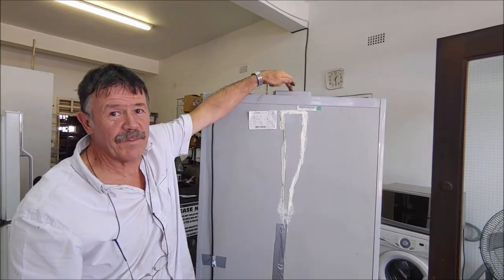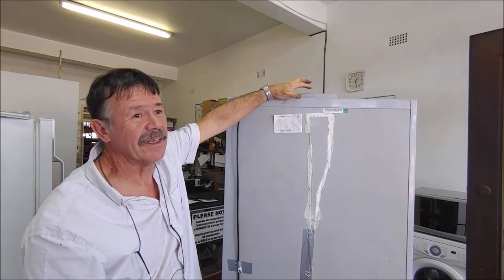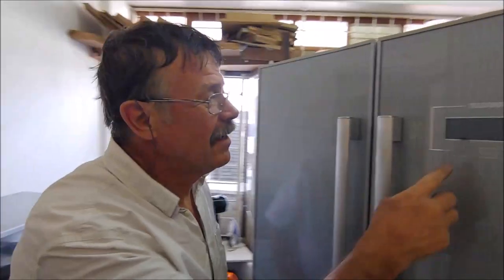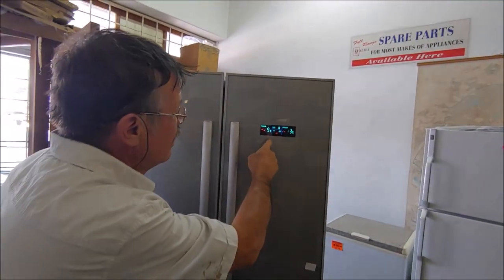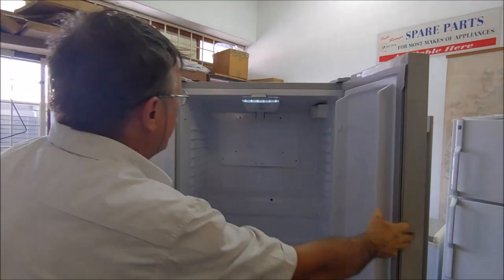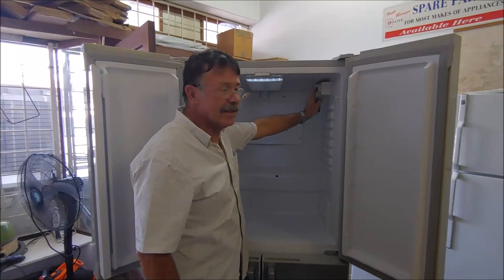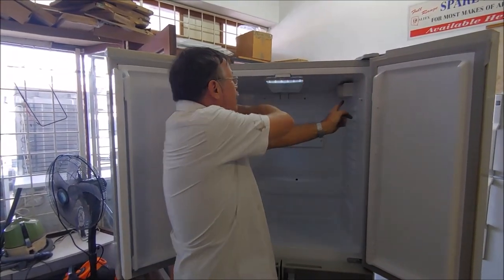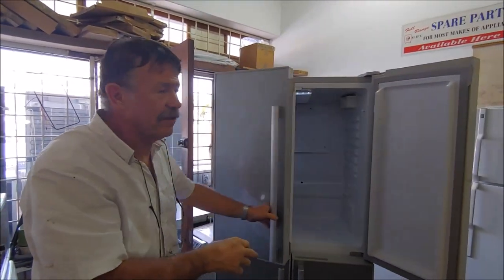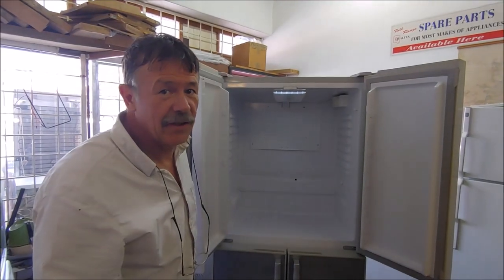On the top is the PC board that controls — or used to control — the functions. It still controls the display, and you can still adjust things on the display. This is the cold plate that I fitted — it's running and getting cold now, and the thermostat's there. It's got two light switches and it works. I ran it down to zero degrees Celsius just now. Now it's all together, so I'll just see how it runs and how it cycles — but this is how I convert these fridges once they develop an internal gas leak.